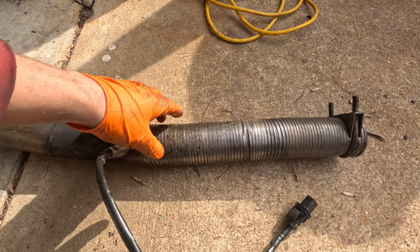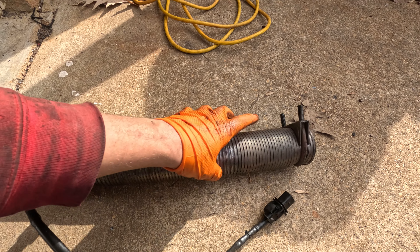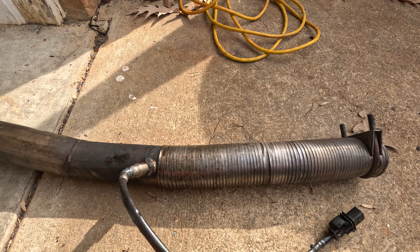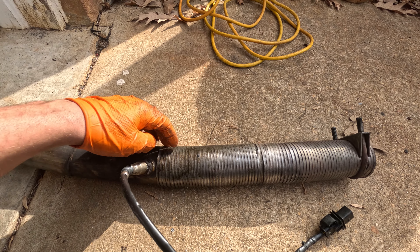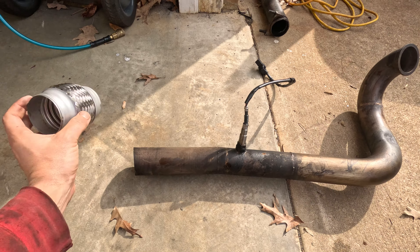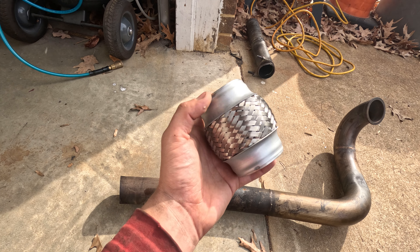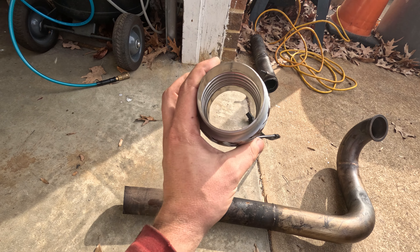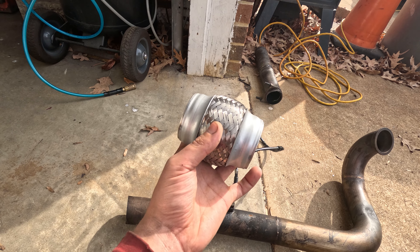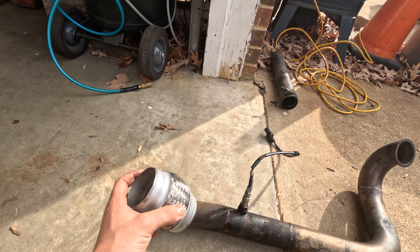Got the downpipe out. Now you guys can actually see the fix for this. If you're ever on a road trip and a bunch of stuff breaks, all you need is two of these clamps, some of this, some way to cut it, and a sawzall to cut your bad chunk out. I'm going to go ahead and slide this off and start mocking up the stuff for the flex pipe. I got this guy right here — it's just a four inch flex. I think I had maybe a six inch one in there before; this one seems really small. Probably not a bad thing. The old one, I had a bigger one in there because I didn't have solid motor mounts, so it needed more wiggle room. This one will hopefully work a lot better now that I have solid motor mounts.